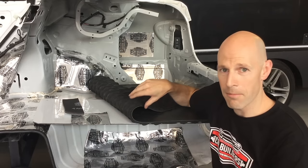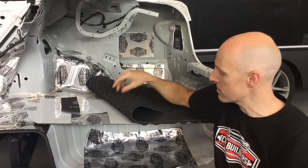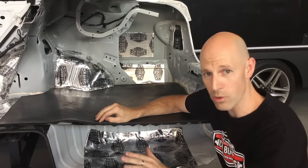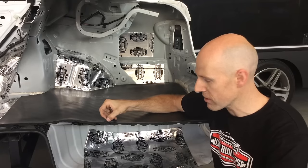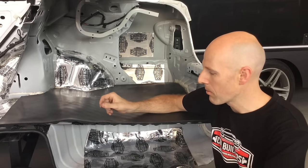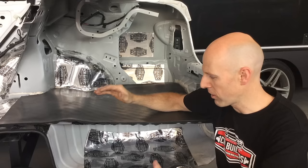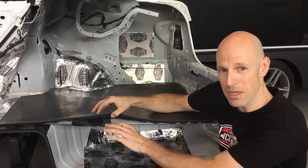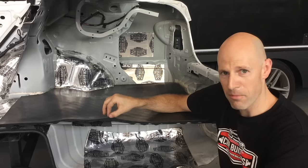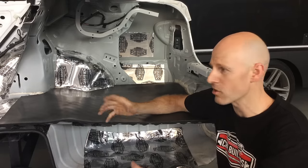The third product is our mass noise liner. This is a Stage 2 product as a carpet underlay, but it's a premium carpet underlay. It still has a foam on the bottom as a decoupling layer to separate contact between surfaces, and it works great as a thermal insulator. But it's got the addition of a mass loaded vinyl, which is a noise blocking material commonly used in the commercial industry. In luxury vehicles upwards of around $80,000, you'll find dampening mats in key resonant areas, a cast layer of foam, and then mass loaded vinyl right over the surface. In cheaper vehicles you'll usually only find this on firewalls to stop engine noise coming through.